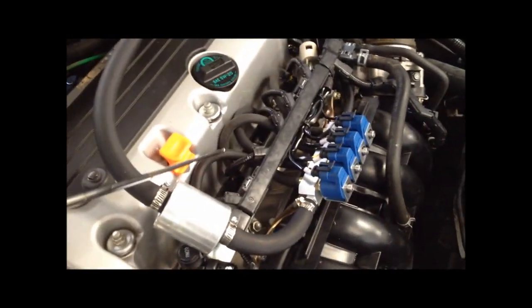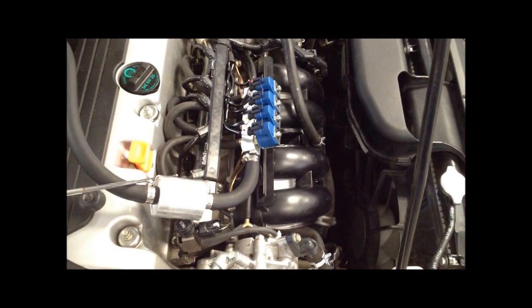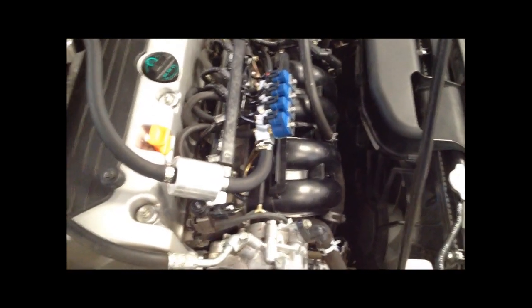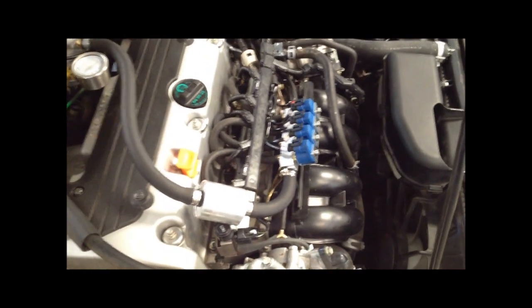You can see the output lines going down to the injector nozzles — a little difficult to see on this car. They're drilled and tapped right alongside, about a half inch apart from the gasoline injectors. You want to mount those as close as you can to the fuel injectors and as close as you can to the actual end of the inlet manifold, so there's less distance for the gas to travel to the cylinders. The closer you can get that, the smoother your switchover will be, and the shorter these lines are from your injection rail down to the manifold, the smoother your switchover will be when the system first kicks in — because you won't misfire from a cycle not having gas down into the cylinder due to a long gas path.